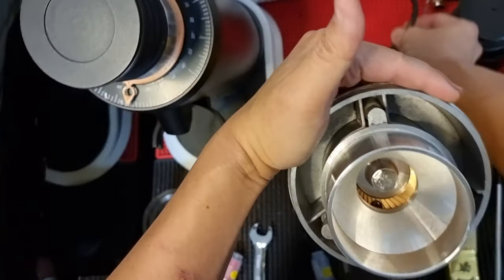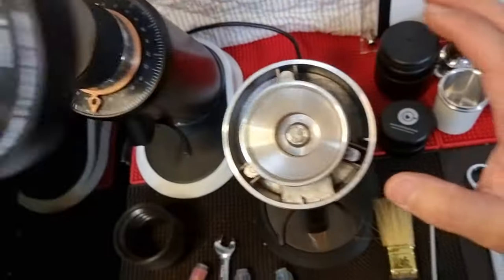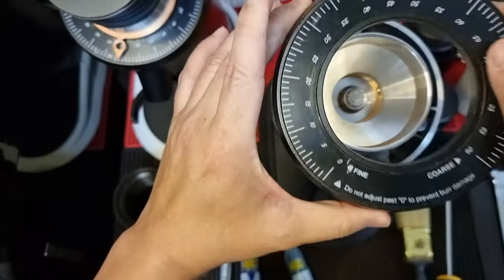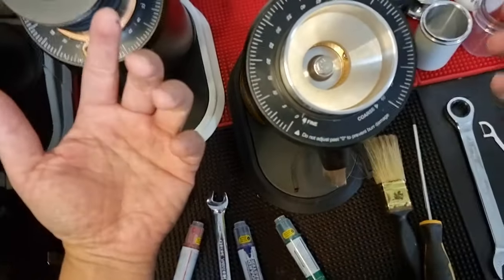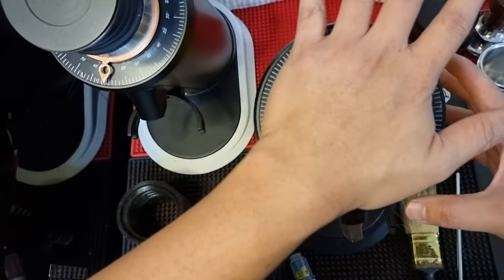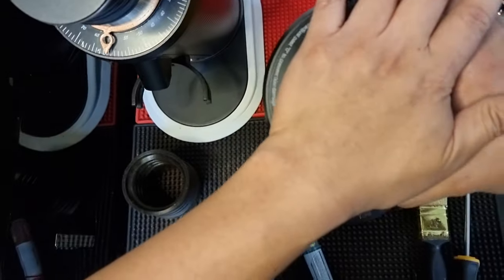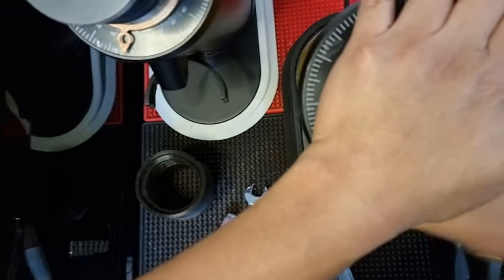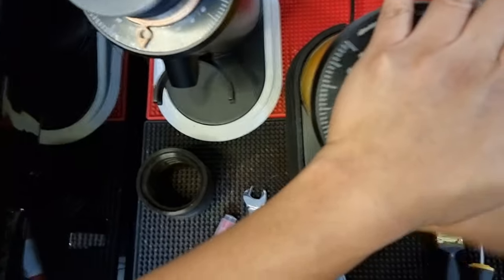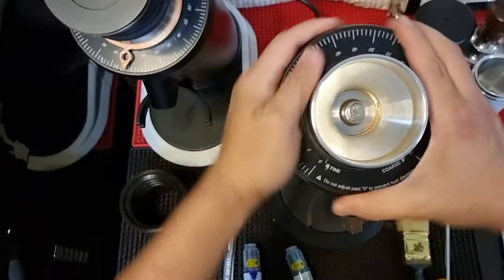Be careful — the edges here are all very sharp. Now it's properly seated. When you want to screw the collar in, I've also learned this technique from a subscriber: he showed me that you just press on the center and then turn the collar — do not force the collar. Press it down, then you turn the collar. Don't push on the collar itself. Turn all the way until it cannot be turned further.